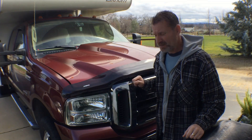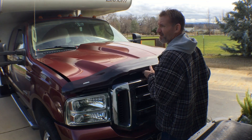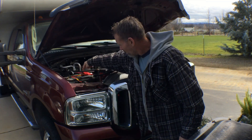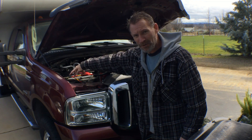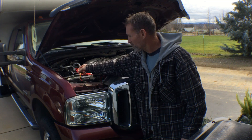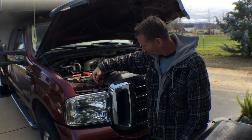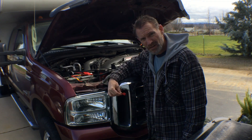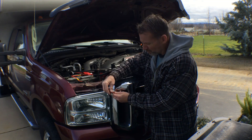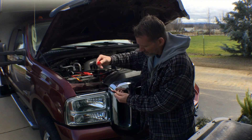We're out here at the truck. What I did on the truck: I've got the positive and negative lead coming off one of the batteries in the truck, with a 30-amp automotive style fuse inline on the positive side. Around 10-gauge wire through the frame bracing in the front and out through the grill. I've got the other Anderson connector there with a waterproof cap on it. You can just pull this waterproof cap off just like that.